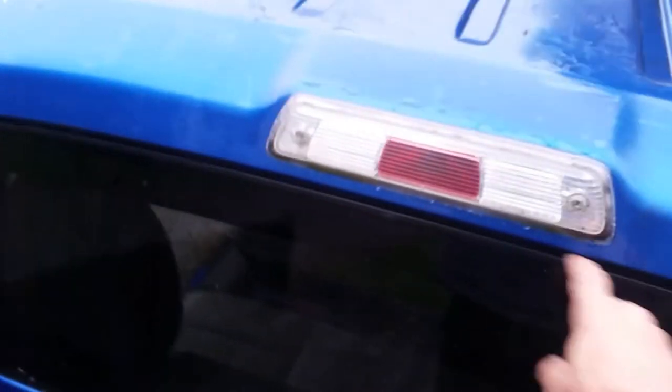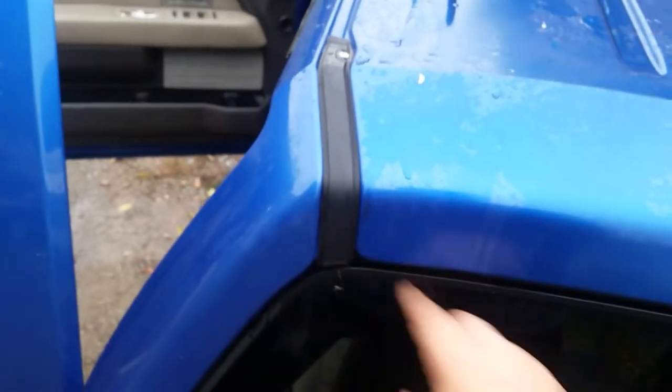You can see how wet it is there. So for now we'll push this back. On a sunny or dry day I'll take this to the car wash, take a high pressure hose and go all the way around that seal and up on the top. Then clean this out as best I can and get a tube of black window sealant to go around this window — I think that'll take care of the issue. It's definitely leaking around this window, not so much around the light or the rivet.